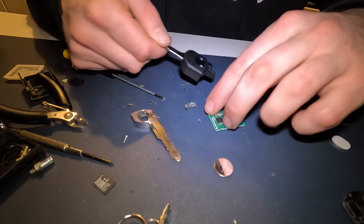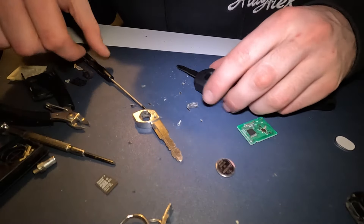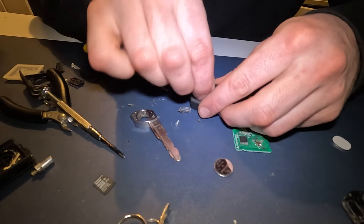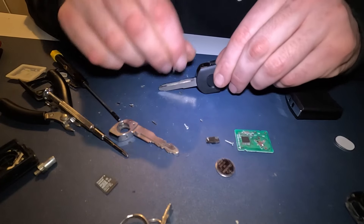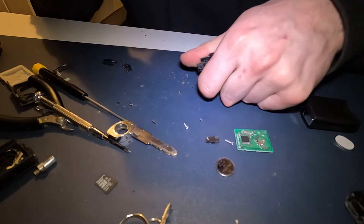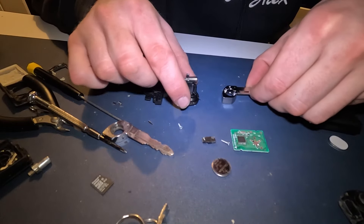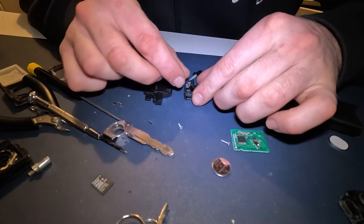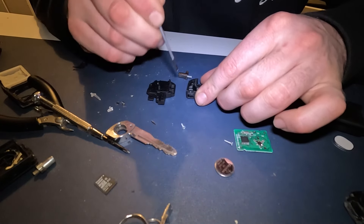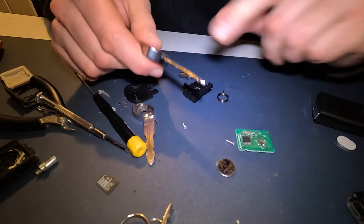So that will transfer across to the new one. The new shell also happens to have a screw in it already — they must send a spare one. Screw out the back of that one as before — don't lose that. This will pop open, just watch the spring so it doesn't fire out and take your face off. Move all the plastic junk aside. Let's put the immobiliser chip in there before we lose it. It doesn't particularly matter which way round it's in — once it's in the hole and you put the cap on it, it'll seal it in. Discard the spare blade — you can keep it if you want, but your original blade fits.